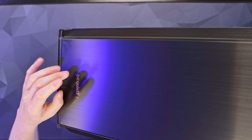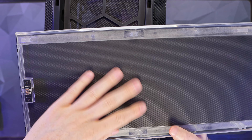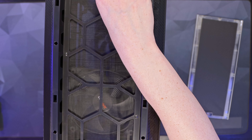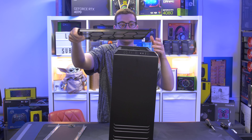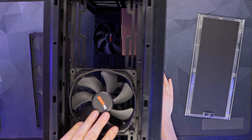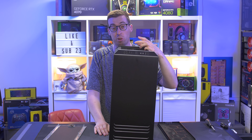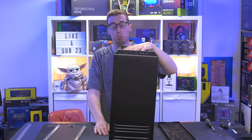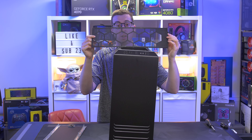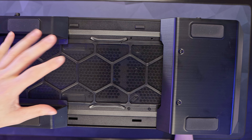There's nothing much else on the front panel — just a nice brushed section and the Be Quiet logo at the bottom. You can pop the front panel off; it has sound-deadening foam on the other side and push-pins for the RGB strip. Inside there's a large dust filter you can lift out to clean. Air is drawn in through the side vents. There's a pre-installed Silent Wings 3 140mm PWM fan, with space for two more, supporting up to a 420mm radiator — or you can use 120mm fans for a 360mm rad. There's also a fan slot at the very bottom.